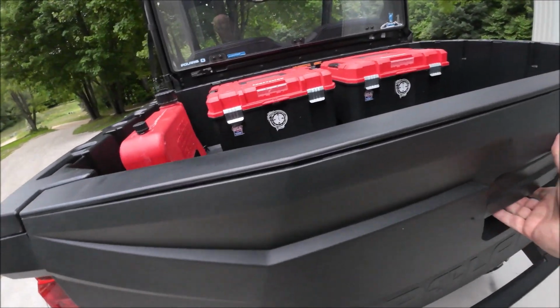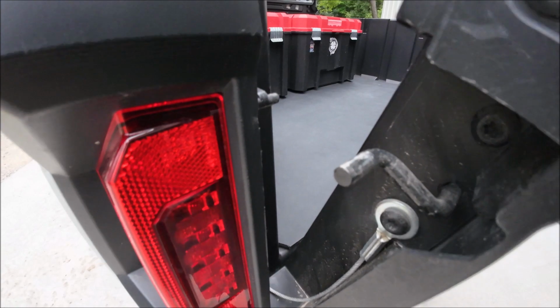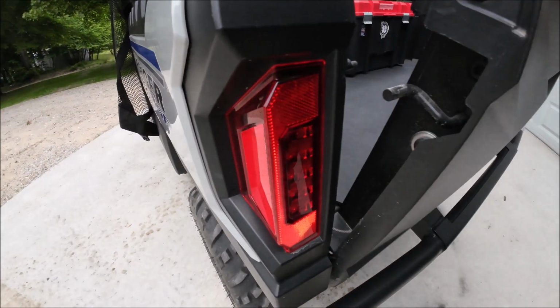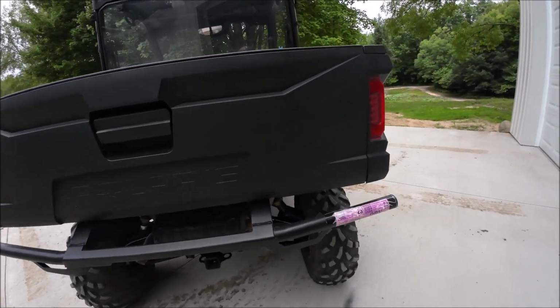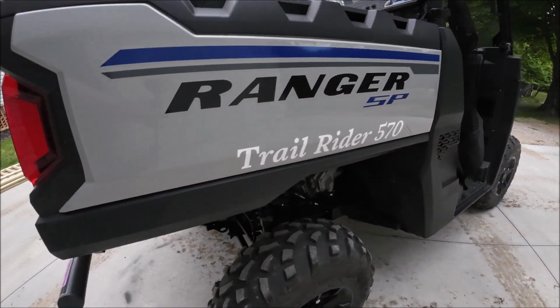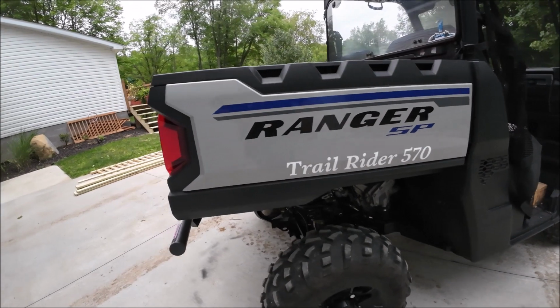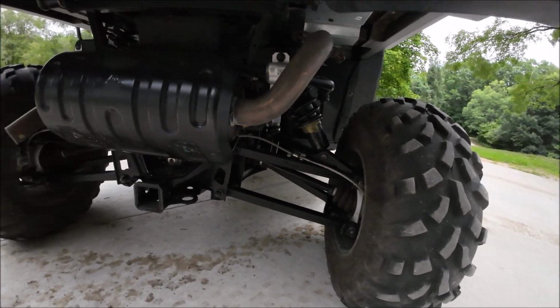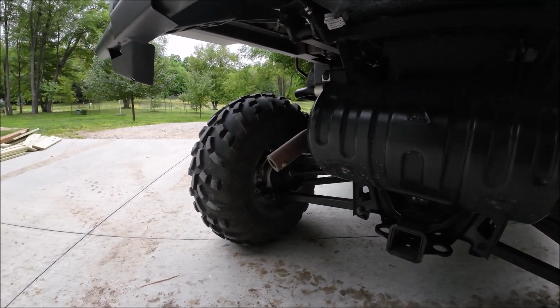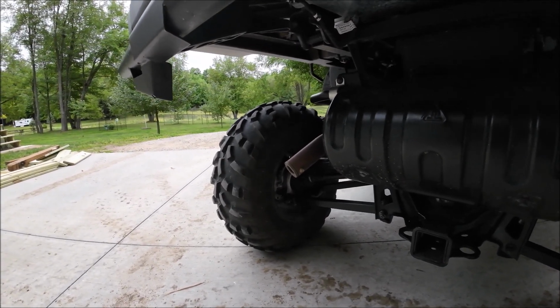Like I say, on the tailgate here, this is my second complaint. If you notice right here, the latch, if this tailgate slides over, see it hits right there. Then of course, if you follow my channel, you know I've had issues with the clicking in the rear end of it. I took it to Babbitt's, who didn't fix it right. They replaced both rear axles. Well, that wasn't the issue. It was the brake pads. The brake pads have a square hole and you've got a round pin, and after a while, they start clicking.